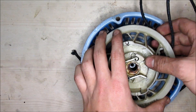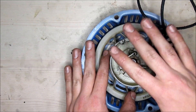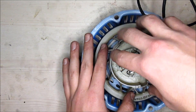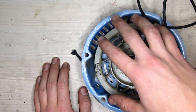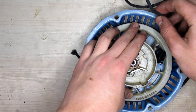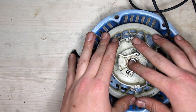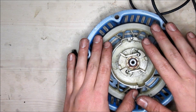All pull starters, once you get them set into their correct spot, you want to turn counter-clockwise. Turning clockwise will destroy your spring, so you want to make sure you go counter-clockwise while you're doing this procedure. Keep twisting until you can't go any farther — then you know that it is complete.